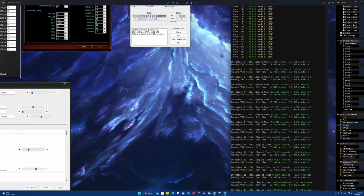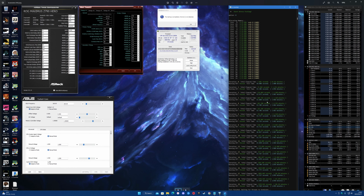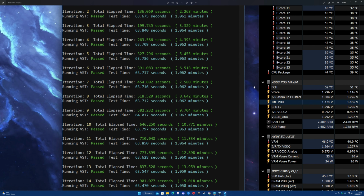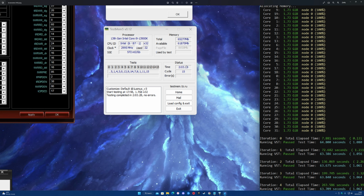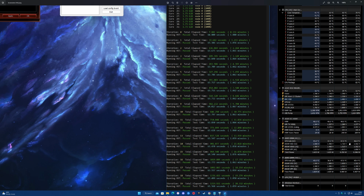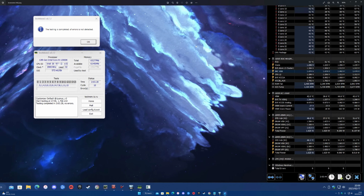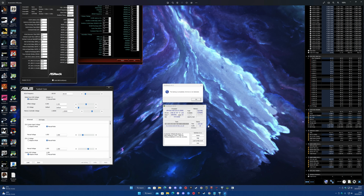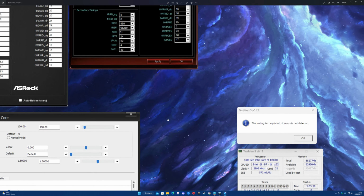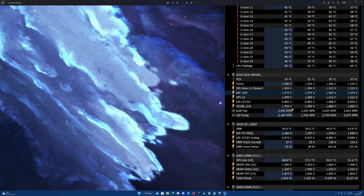So how on earth did I pass 2 hours? Simple. The timings. When the timings decreased, it decreased the strain on the data line. And basically, it made that whole infinite VDD2 conundrum you run into with VST or with the 1usmus, it made it null and void. And very interesting that, like, 1usmus, that's how it reacts to heat, number one, because, well, from the screenshot you can see the actual operating heat was quite high with your rank. And then, so heat's a big factor. Heat in 1usmus will make your over tight timing suffer, and you will end up in a situation where you keep on seeing increase VDD2, increase VDD2, increase SA. The whole time. Just increase whatever value.